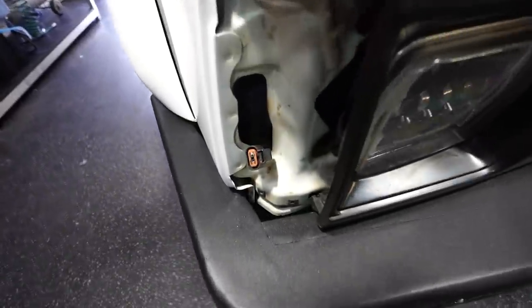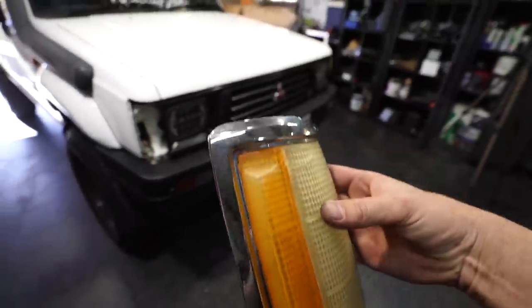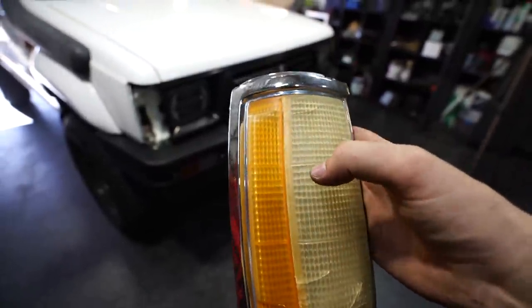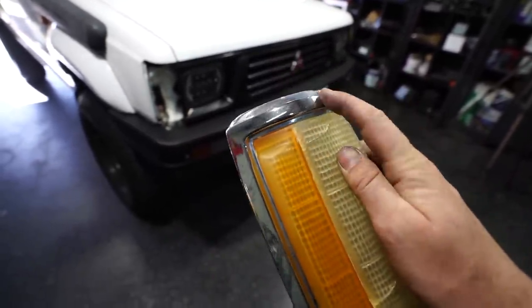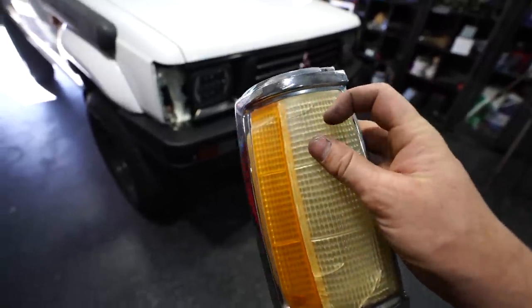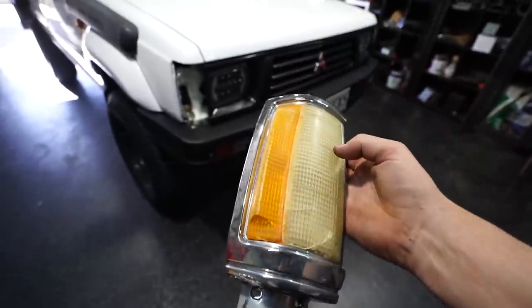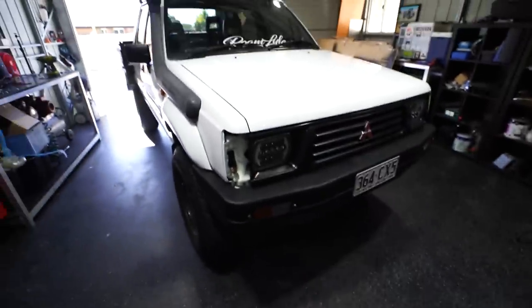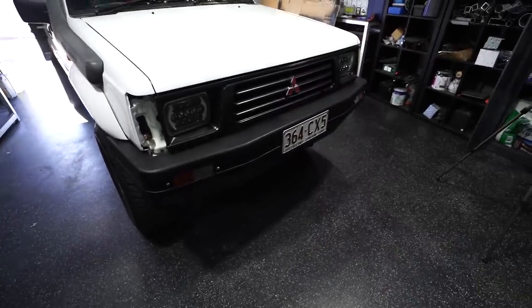I've bought one wiring harness for a spotlight but it comes with two plugs, and then we're just going to extend one plug up to the roof bar so we can use the same switch for both lights and only have to buy one wiring harness. First things first, I need to mount the bull bar one, then move on to the roof rack and get it all mounted, then look at wiring them up. Before I start mounting stuff I'm going to paint these because I don't like the chrome. I'll hit it with a bit of scotch bright, paint the outside with normal paint, and paint the clear bit and indicator in a nightshade tint spray, then they'll kind of just blend in.